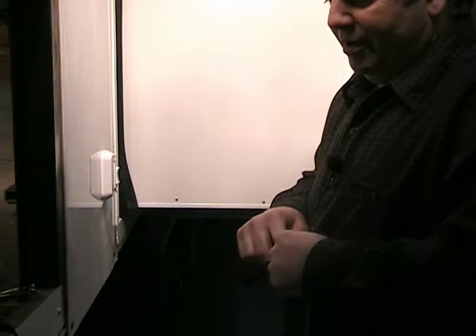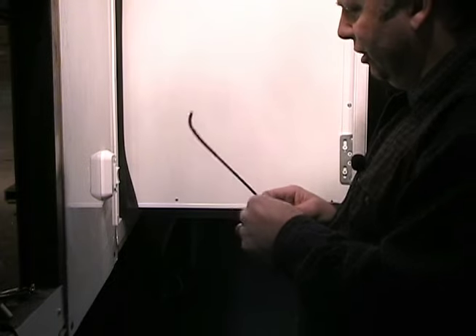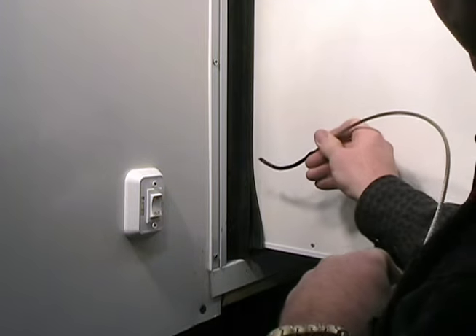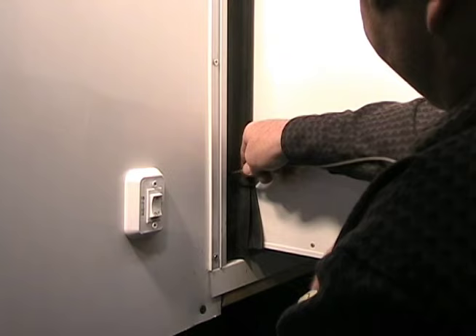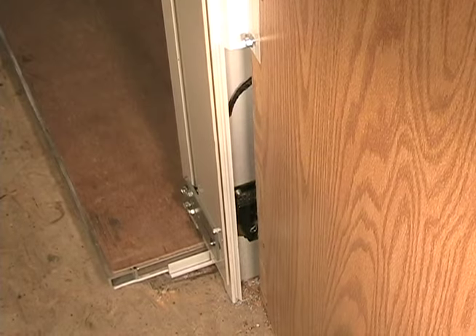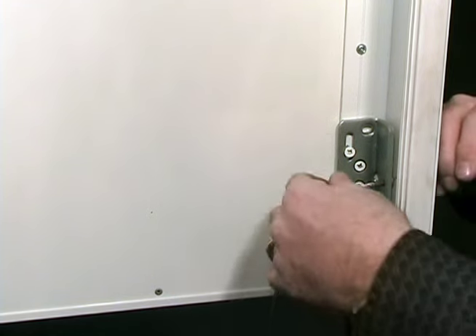In some cases, if you have lithium grease available or something that can help lubricate the cable, you can also use that so it slides through more easily. Push the cable into the hole with the radius pointing in the direction of the motor, which is up in this case. Then start the cable in the hole, push it through, angle it up, and keep pushing it until it goes all the way into the coach. Then take the ball and place it back into the bracket with the keyhole, and place the grommet back in position to keep the cable in place.